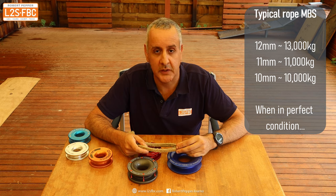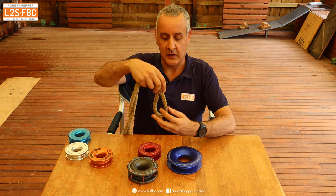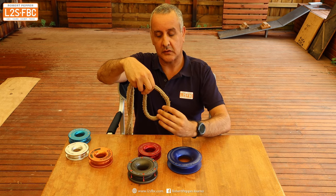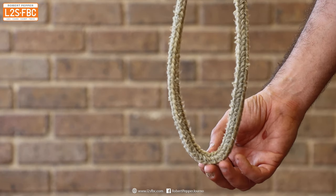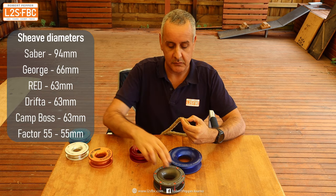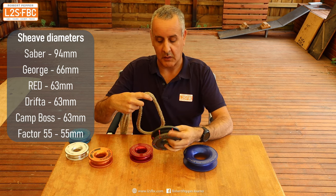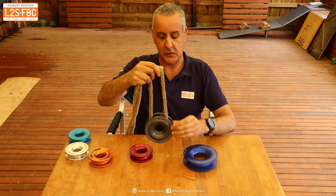Given that most four-wheel drive rope is around 8–12mm — let's say 12mm — you really want a DD of at least 60mm, preferably 80 or 90mm. Any less and the ring will still work but places more stress on the rope, as the inner portion is under compression while the outer is overly stretched. Of the rings tested, four are similar in diameter; the Saber has the largest by quite a margin, but surprisingly the Factor 55, despite being wide, has only a 55mm internal sheave diameter.